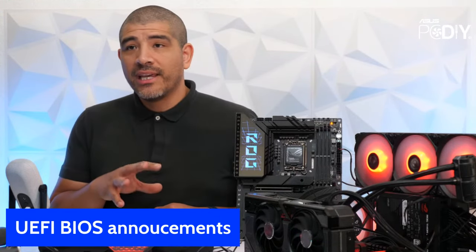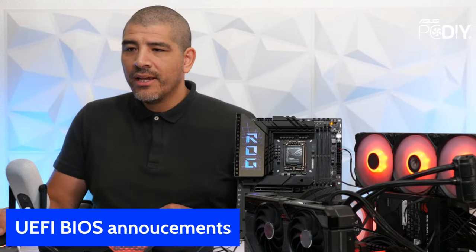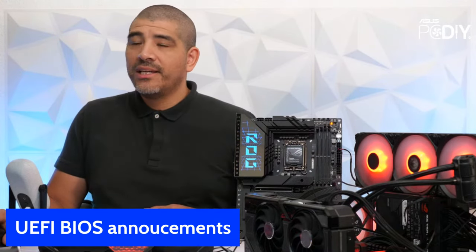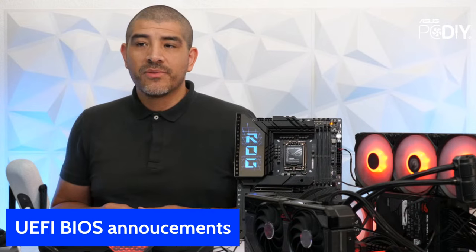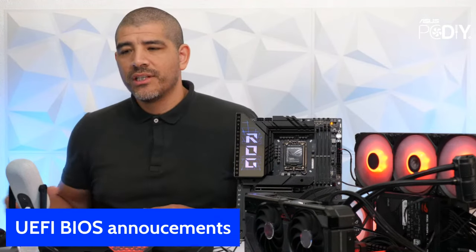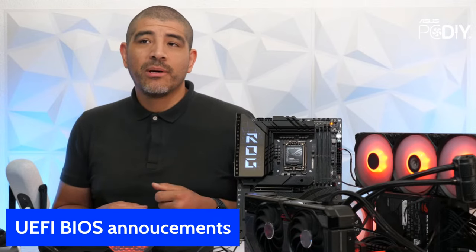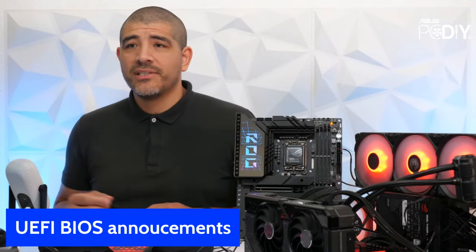In addition to that, for the AM4 platform, there's a number of motherboards that you're going to be seeing that are receiving the latest AMD AGESA. Now, as I always try to preface, for those of you that have AM4 based motherboards, if you're going to be making the update, keep in mind that anytime you make any changes to the AMD AGESA, that can change underlying auto rules. It can change quite a number of different parameters. So if your system's running stable and reliable without any issues, there's no reason for you to upgrade. The majority of the latest updates, if we roll back a couple of releases on AM4, are probably going to be specific to USB interoperability and compatibility, fine-tuning some compatibility elements for maybe newer devices that are coming to the market.